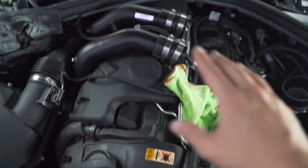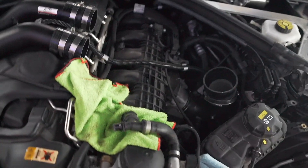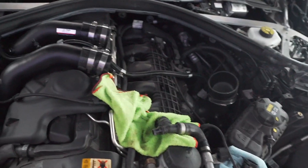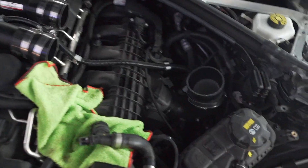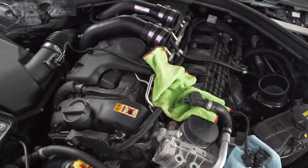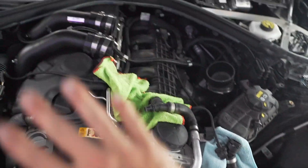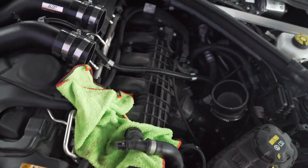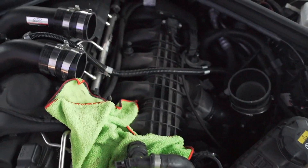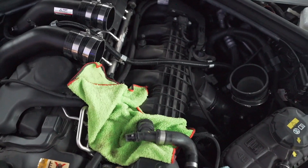I also took off my carbon strut brace to make it easier to remove the J pipe clamp. Here's how the cooling works on the S55: hot air goes to the front of the car, through the intakes, through the turbos, out through the charge pipes on the hot side, and then into the charge cooler — whether OEM, Active, CSF, or Mishimoto, they all do the same thing — cool the air more. That cooler air then goes through the cold side J pipe into the throttle body and back into the engine, producing more efficient, cleaner power. These engines love cooler weather — boost season, everybody knows that.